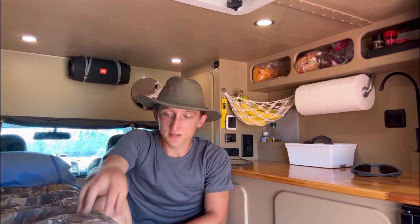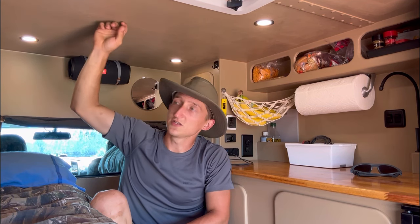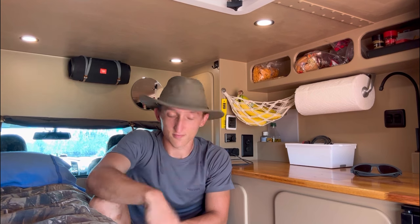On top of that, this truck camper is specifically built to go to Alaska. It's inch-and-a-half high-density foam with two layers of Mylar Reflectix in between, which I believe brings my R-value to like R-13-something, plus the sheet metal, plus the half-inch plywood. I've got a 16,000 BTU heater — more heat than I could possibly need even at negative 25 to negative 30, which is what I expect this truck to see. If I put a canvas pop-top on that, there goes all your R-value; you have zero ability to retain heat. You're just back to winter camping in a tent. I've camped in Yellowstone at negative 15 and didn't care to do that again, not without a heater and proper insulation.